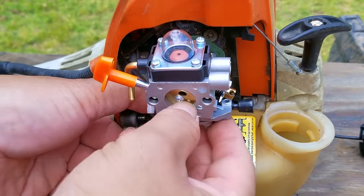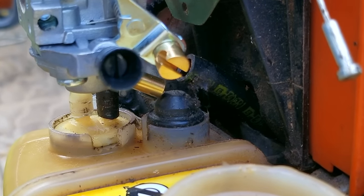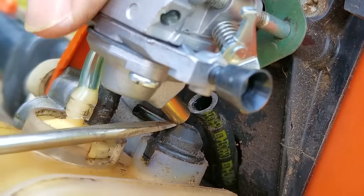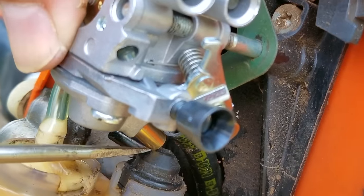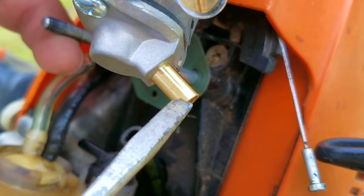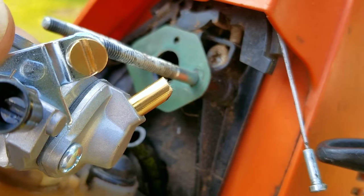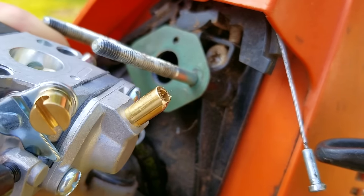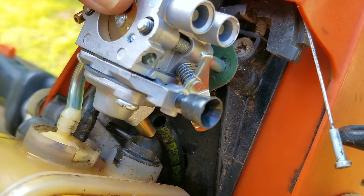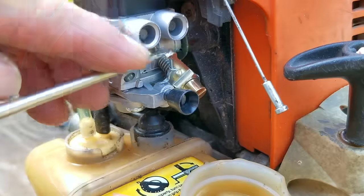For some reason I seem to be stuck and can't push the carb against the engine. Once I took a look around, I realized the brass port is hitting the emissions port on top of the fuel tank. I tried to work the carb around it and even tried prying on it, but I was really concerned I might break it. It looks like the brass port is either too big or just too long. To make it work, I'm going to clearance only the part that's hitting it — I know I'm going to get some criticism for it, but I think it's the right thing to do, especially for an aftermarket carb. After sliding it back onto the studs, it now clears the emissions port, and once I line up the brass port with the impulse hose, the carb now sits against the engine like it's supposed to.